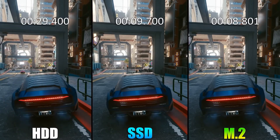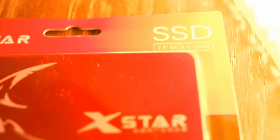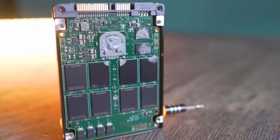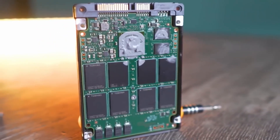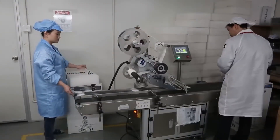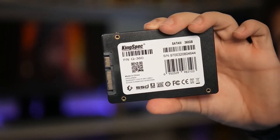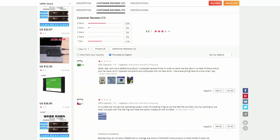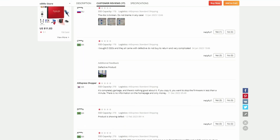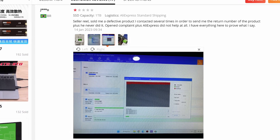The problem is in their quality. Such drives are made literally of rejected semiconductor chips which, for one reason or another, were not suitable for solutions by famous manufacturers. Small Chinese shops purchase them, run some tests — though I'm not sure how accurate — install the cheapest controllers they can find, and sell them. You may get lucky and such an SSD will work for more than a year, but there is always a chance that a newly purchased drive will have problems out of the box. And in about a year, it will die, taking all your data with it into its silicon grave.